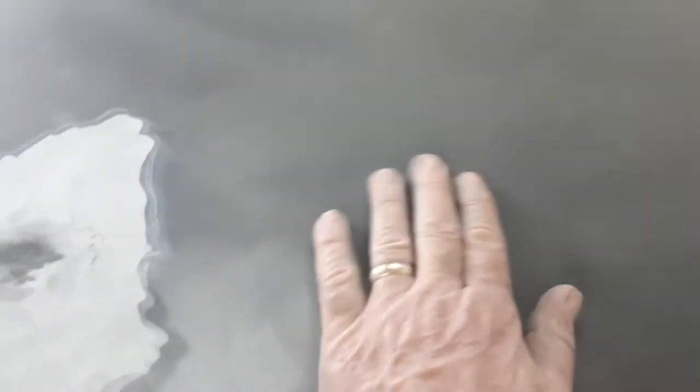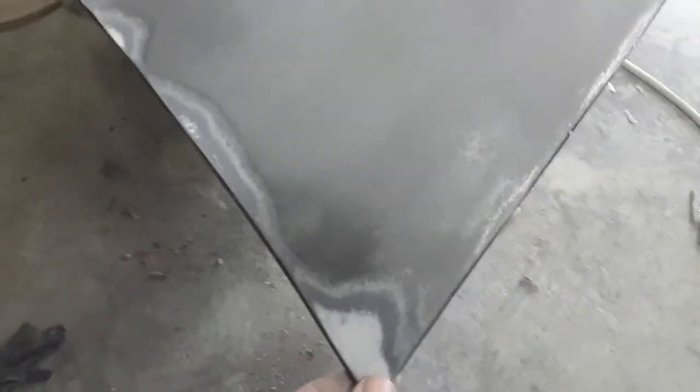What I did was DA'd into the paint to make sure I got all the cracks that go deep into the fiberglass. There were a couple more spots over here where it looks like it was hit with something and did damage right into the gel coat, so I just took the grinder and took that out.